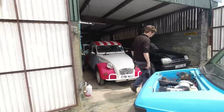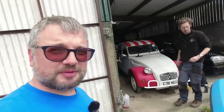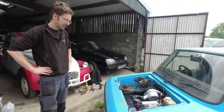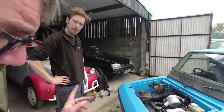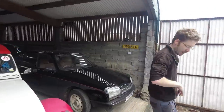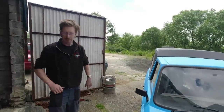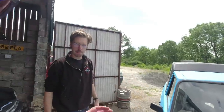Right, now we can actually adjust the thing. Unfortunately Tim was following me in and noticed just how blue the smoke is with Foxanne, although we did discover that the breather is not breathing all that well, so I've just got that sitting in some carb cleaner to try and clear it out. Blocked breathers seems to be a developing theme on the fleet at the moment. Okay, so while you're here - I presume these are tapered bearings, which is why we need to adjust them? Yes. So we'll have to jack it up, and you just want a little bit of play - just a touch - because as you drive it, it warms up and the bearing will expand, and if it's too tight then it's a problem.